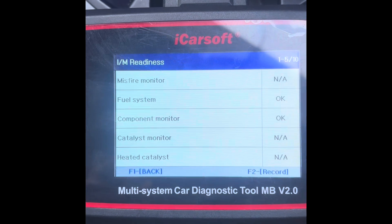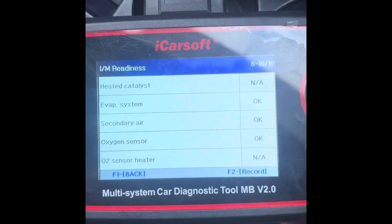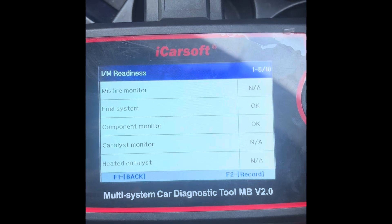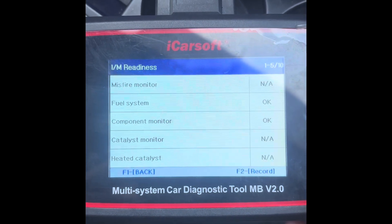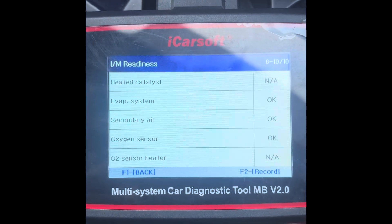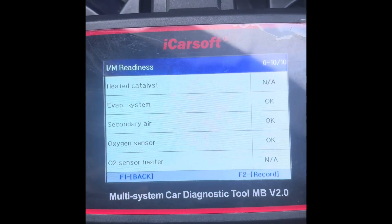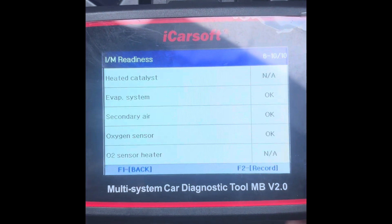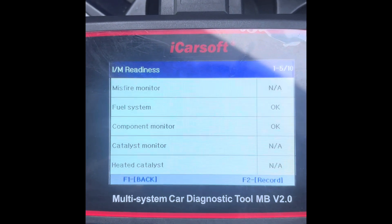This is following on from the inlet manifold having a bad air leak. The lambda sensor readings were way out of whack — it was a flat line and there was just nothing on the lambda sensor readings. I did as most would initially and just changed the lambda sensor, which made no difference, and then came to the conclusion that it was unmetered air, which was right because the inlet manifold gasket was leaking.